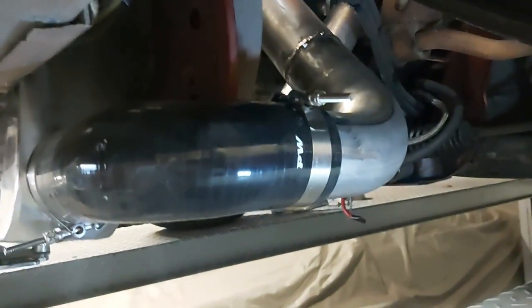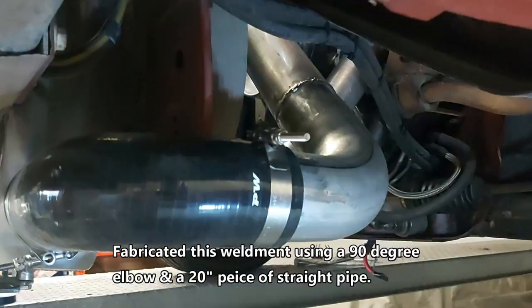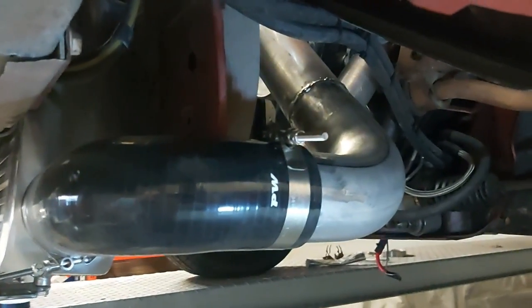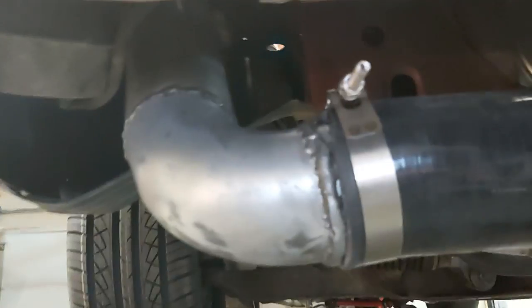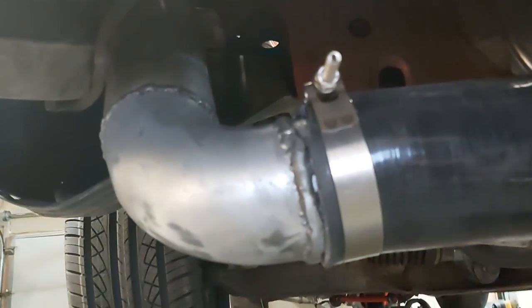Here's a look from underneath guys — intercooler, our 90-degree coupling, and of course our fabricated elbow with straight pipe running up to our blow-off valve sleeve. There it is coming out of the intercooler with the clamps on there. Here's the intercooler, and here it is coming into the intercooler, and again going up to our compressor outlet up in the fender. I cut a hole in there and I'll show you guys what that looks like once the car is lowered.